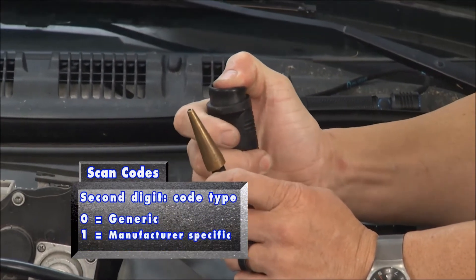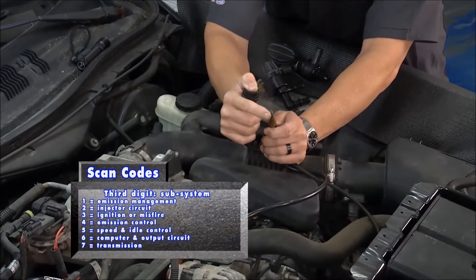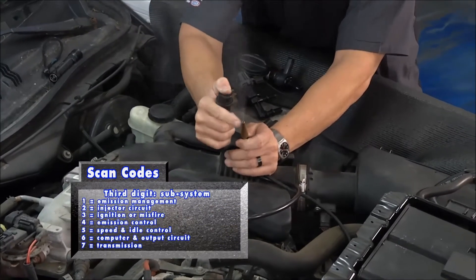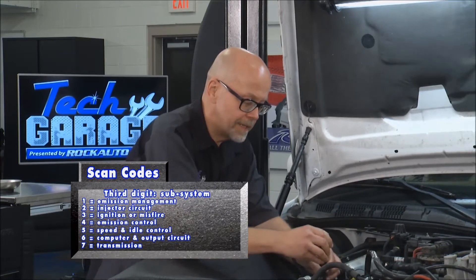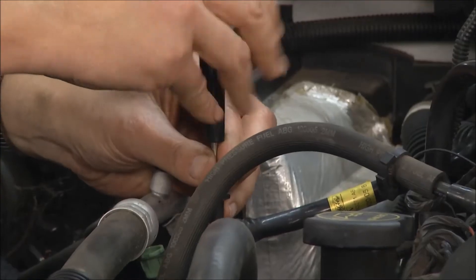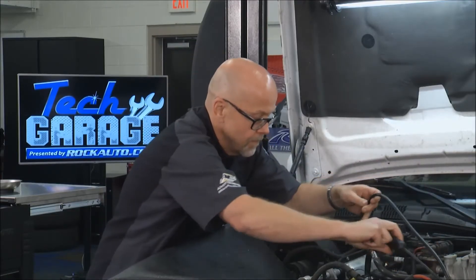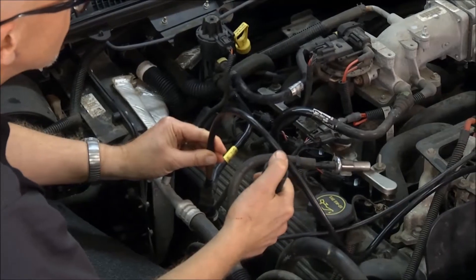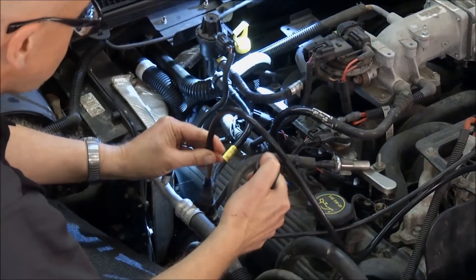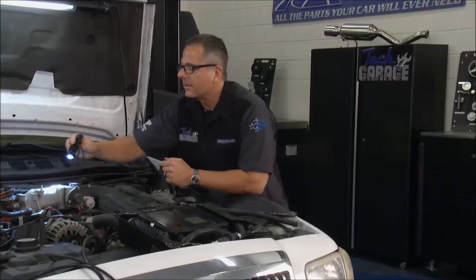You can see when I push the button, it's actually going to develop some smoke, and when it develops some smoke, it's going to go through the system. There it is right there. Tom, if you walk them through, how are we going to introduce this into the system? There's a port right here that has a Schrader valve in it, similar to what you'd have to put air in your tire. I'll just pop that out, and then I can introduce the smoke. When you do that, it's going to run through the whole system. Once he starts introducing the smoke into the system, I got a flashlight right here — I'll start looking for it.